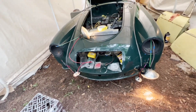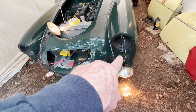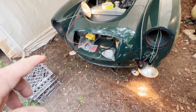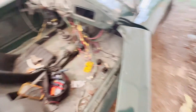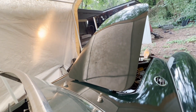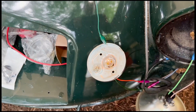All right. After a few hours of work, got the wiring up front straightened out, separated, and run neat. Have headlights working. Stuff's just mocked up and dummied up — I've got to scratch and get good grounds. Got the parking lights done. Next will be the turn signals — it's going to take some deciphering up there under the dash; some paint got on some of the wires. Let me go grab the high beam switch here so we can see that work. Highs and lows work. In just a few minutes I managed to get a blinker working, so if I got one working, I can get them all. And now left front.